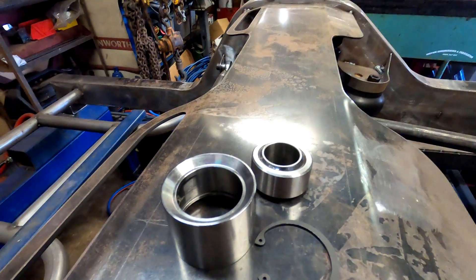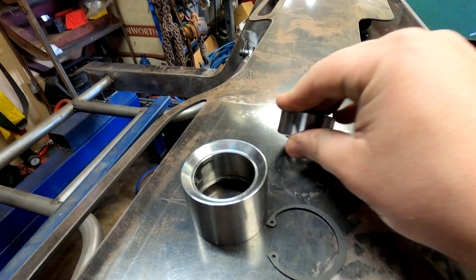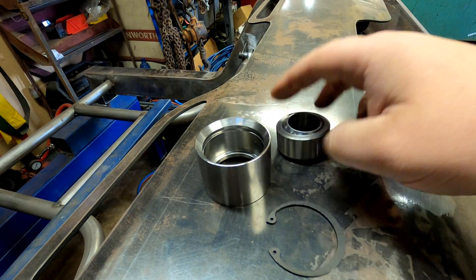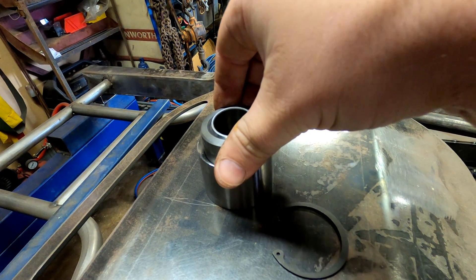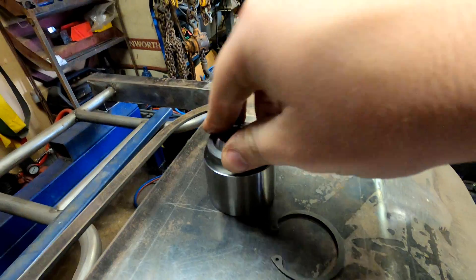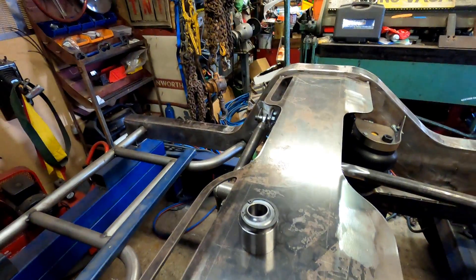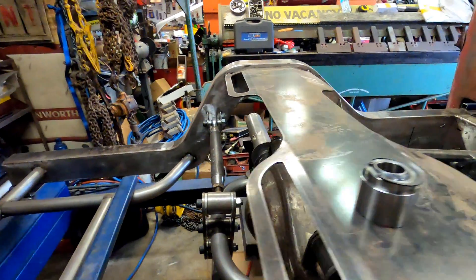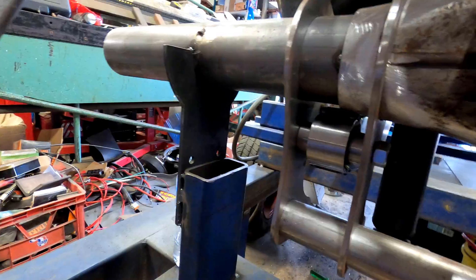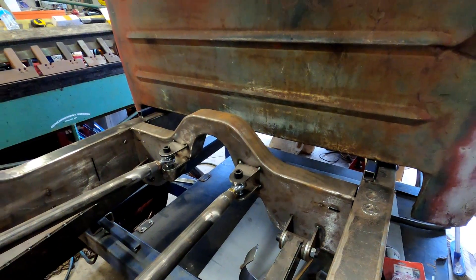The last option we have is what we call a uni-ball — essentially the same as the heim but without the threaded shaft. What they do have is a sleeve. You weld the sleeve onto your arm and they're a tolerance fit, so you sometimes need to press them in — they're very tight so they don't slip around — and then there's a circlip retainer that goes in on top. I've actually used the uni-balls here on that lower link just there, giving articulation through that arm in combination with the poly bush at the front.